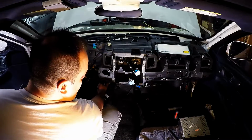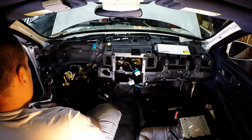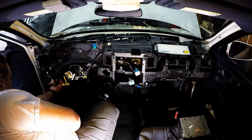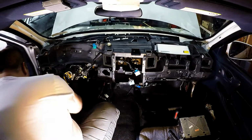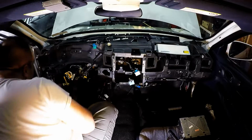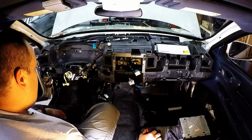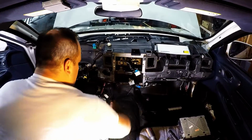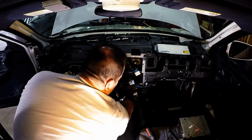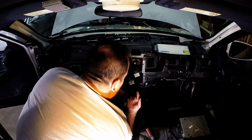We have OBD2 port in place. I have the cable release lever on here. Let's get that mounted to get it out of the way. So I did keep the remote start add-on, and I brought extra ground straps in from the melted wire harness, so that there's grounds for the remote start components that need it.